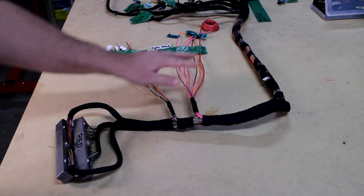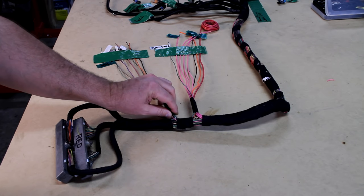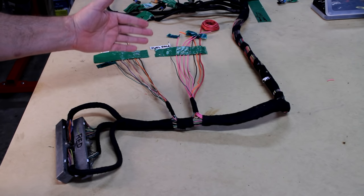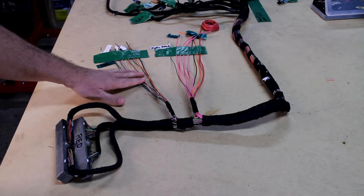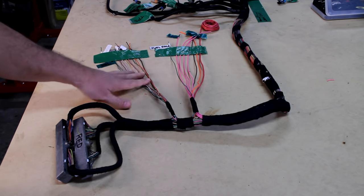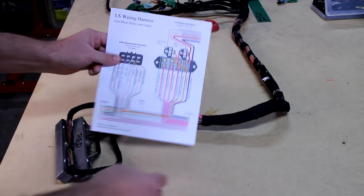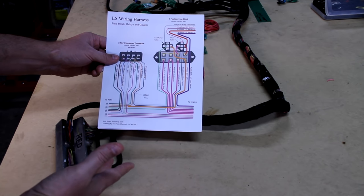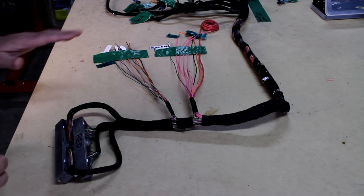This whole leg up here represents all the power - providing power to this harness and to all the sensors on the engine. In addition to those wires, I've got another section for communications to things like gauges, your OBD2 connector, your tach, and your check engine light. I've put together a drawing that will be available as a PDF in the description below.